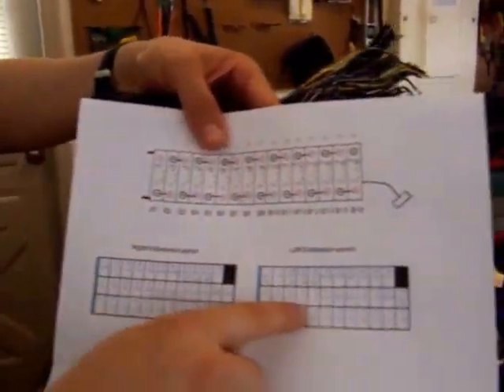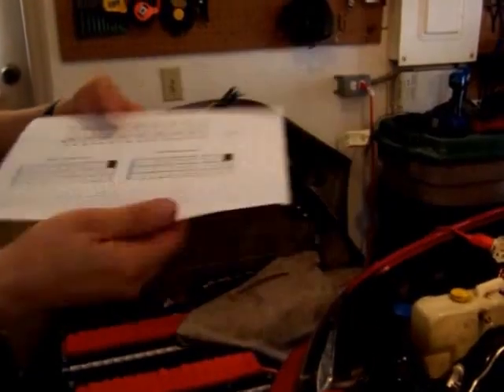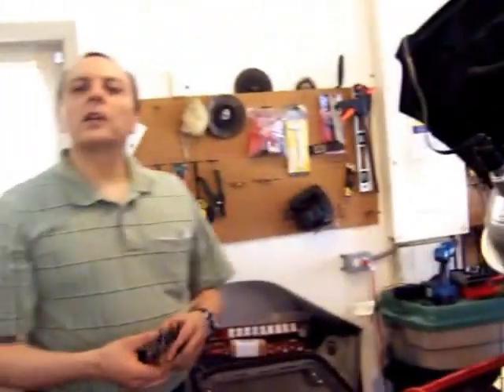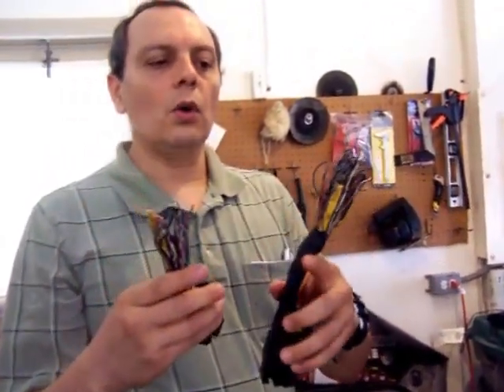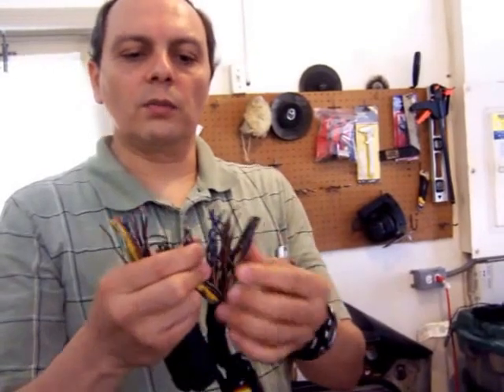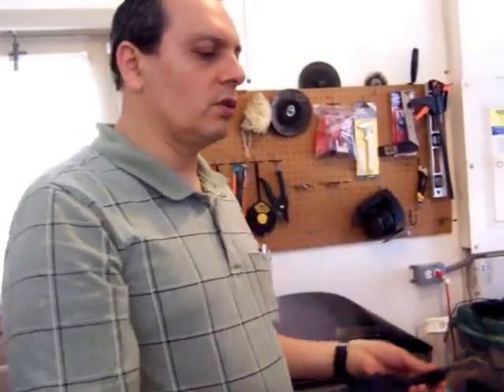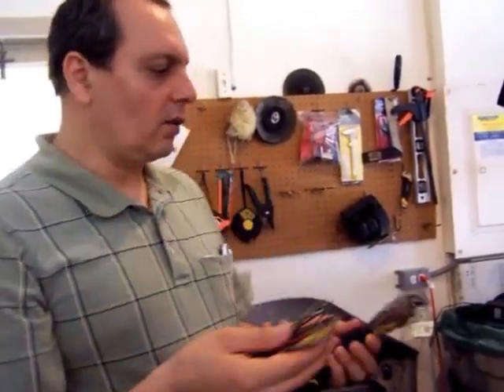I did a better diagram for my batteries now, so I know very well where all the connections go, where every cable goes, and the voltages and the way they are connected. Something else I did is I finally got rid of all the cables that were in the car and were not really related to the conversion. Just to give you an idea — these are the two connections that go to the computer of the car, to the old computer when it was a gasoline car. Just look at this — so many cables. These are very complex systems, and these are just the ones going to the computer; there are many more cables going to sensors, airbags and things like that. I got rid of a lot of mess and cables and put all my cables in this blue conduit, just to make it look better and cleaner.